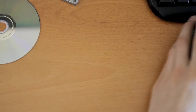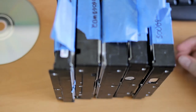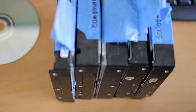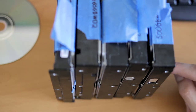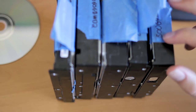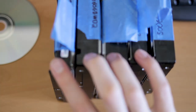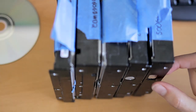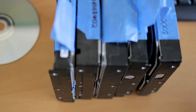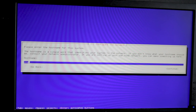This is a great setup for when you have mixed drive configurations. For example, you might have a 500 gig, another 500, a 280 — a pretty mixed configuration. Most RAID arrays don't like this. What SnapRaid does is essentially like a RAID 4 setup: there's a parity drive, everything else holds data, and SnapRaid pushes it all onto the parity every once in a while when you manually tell it to. You can also just take the drives out and read whatever data you want off them directly.